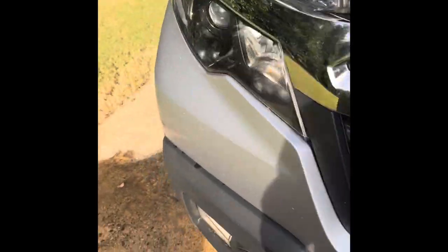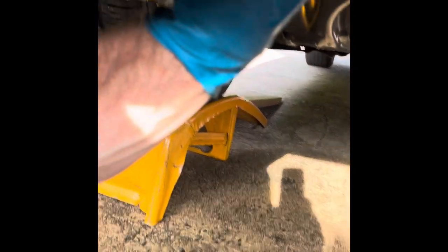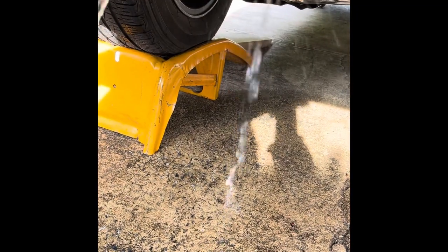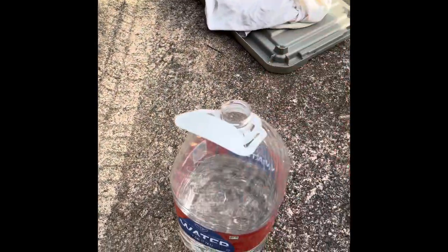All right, everything's hot. Got gloves on because I know this water is going to be smoking. I can reach under here and find that without having to lay on the ground — there it is. Hopefully I can open it without getting burned. Well, I didn't get the plug all the way out but enough to drain it, so that'll have to do. Got all the hot distilled water drained, got the plug back in tight.